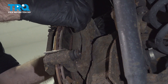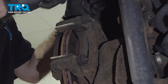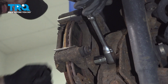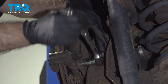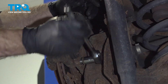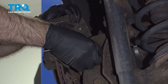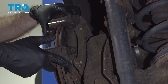Behind here we have two more bolts holding in our caliper bracket. They're going to be 17 millimeters, and we're going to use a shallow socket to get both of them removed. When you're undoing your bracket, I like to leave one of these bolts most of the way out, but still on by a couple of threads — it'll hold your bracket in place for you.